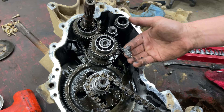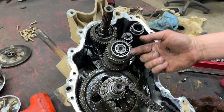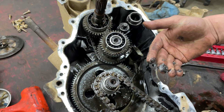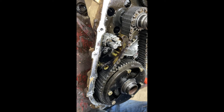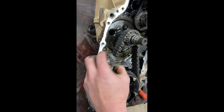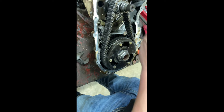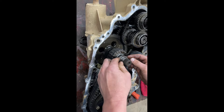Regardless, this has got to come apart to be cleaned because we are going to use this half of the case and we're putting all new bearings in, including everything else. We want to make sure we get all this out because failure to do so is just going to eat up the new bearings. The first thing I'm going to do is take this tensioner off — you've just got a spring here, this pulls out, and then we're just going to wiggle this loose. As you can see that breaks tension on it. Putting it back together shouldn't be too much of a task.